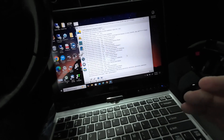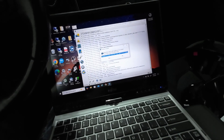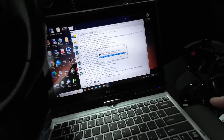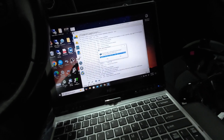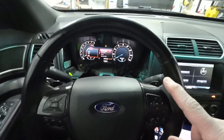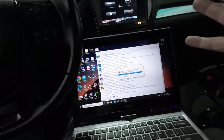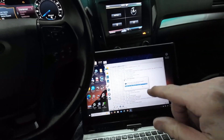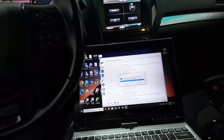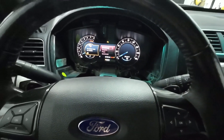The reason we cannot just flash our as-built data from our old cluster into this one — like you would when upgrading a lower trim cluster — is because of the fuel gauge. I was able to flash the as-built data from my old instrument cluster to the new one, but my fuel gauge always read full, which I knew was not correct. The way around it was to go in and manually tick off the things causing malfunctions, because the fuel gauge reads correctly with this in its stock form just plugged in.